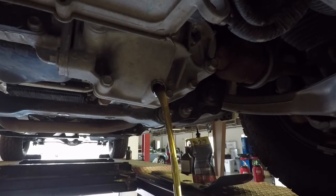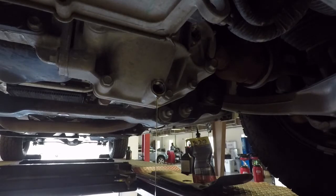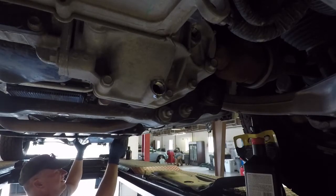I'm going to be filling this up with Amsoil Severe Gear 75W-90 Gear Lube. You can see a bottle sitting there as well as the new EZ-Packs — these things are great. You just cut the tip off, remove the seal, squeeze it and it will just flow right in, unlike the older bottles that were problematic.